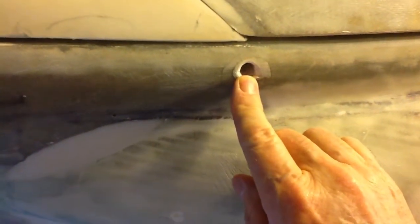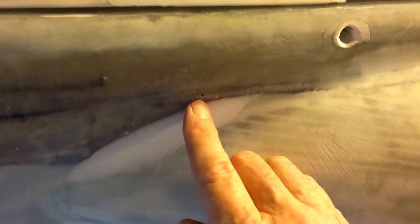There's a bit of security in that you can leave your Cozy outside or open to the public — people are not too likely to know what that hole is for, and even if they do it still isn't going to unlatch until they find this second hole, which you can hardly see, and know what to do with it. The only remaining issue is the springiness of that stainless steel piece — it's a little soft and bends easily. If I push too hard on the keyhole I bend it, and then I have to re-bend it back to shape to make sure it holds the canopy latched in flight.